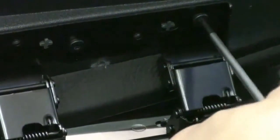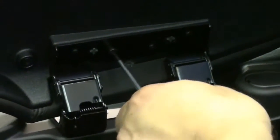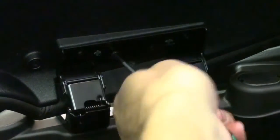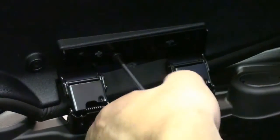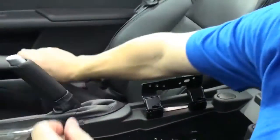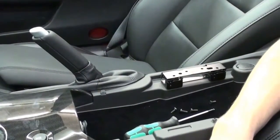When you get to the last two screws, you want to actually hold on to the glove box lid so that you support it, especially when you go to loosen the final one — or else you'll strip that hole out. Once it's out, just be very careful not to scratch it and lay it aside. Then go ahead and lower the piano hinge.